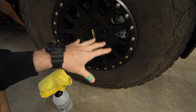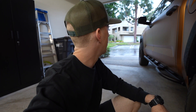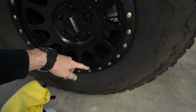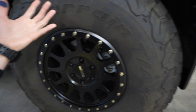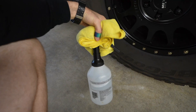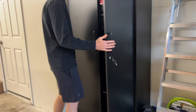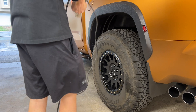So I'll wipe down the tire around it too, and the wheel, and of course the surface that we're wrapping as well. Then we'll grab the heat gun because it's pretty chilly and somewhat humid here, so the wrap is not really going to work with us. We'll use a heat gun even though it has a pretty flat surface — we need it to glass the film properly and then wrap it around up to this edge. Then we'll do a nice face cut, cut out the areas where the hardware is, and give it a nice post heat so it bonds.